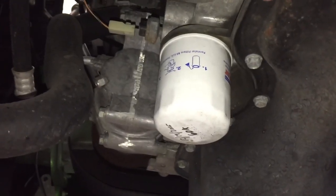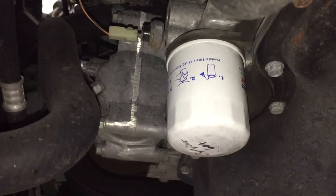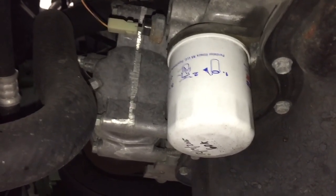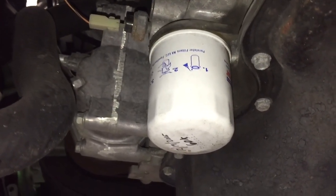That'll promote oil draining out of the engine when you open up the drain plug. You'll find the oil filter at the front of the engine, right next to the oil pan, and it's in a great spot — you just reach up, twist off, the excess drains into the pan, and there's relatively no mess. All my other cars used to have the oil filter on the side of the block underneath the intake manifold — I'm sure we've all been there — and it dribbles down and makes a big mess. This is a lot better way to do it.